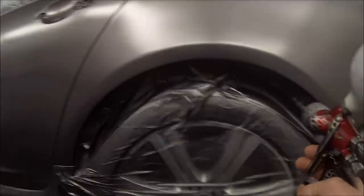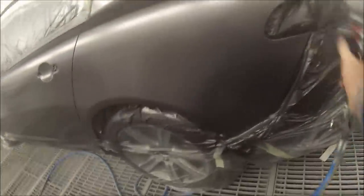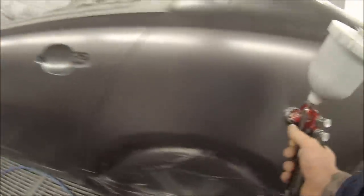I find it's better if you have it a little bit thinner than your base coat because I like it to dry nice and quickly — the more thinner, the quicker it's going to dry. Straight away when that's still wet, you put your blend coat, your tech coat on of your base coat. Two bar of pressure, and you don't want it on as wet as that second coat — just dropping it on so the metallic and the pearl is going to stand up.